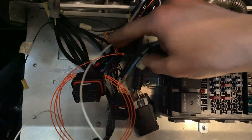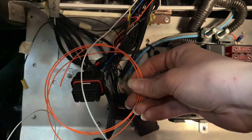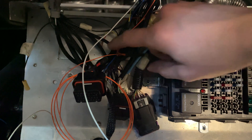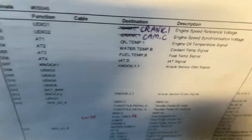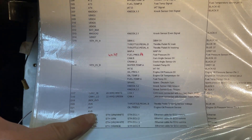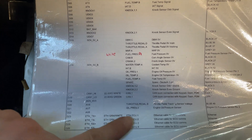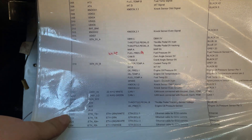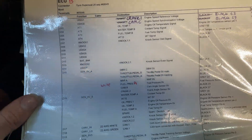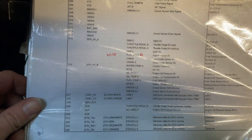So the zero volt and the five volt is wired up and we have a spare now in case we ever need it. Just looking at where to wire the actual sensor — I didn't actually check this before, but we've only got one spare, so I guess it's gonna have to go into analog voltage 8 at B22. Don't mind the D — I never changed the schematic from mine.